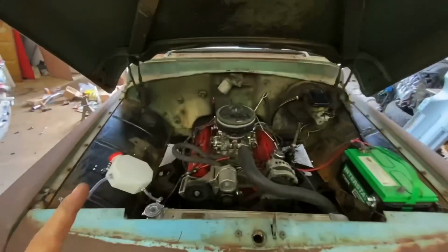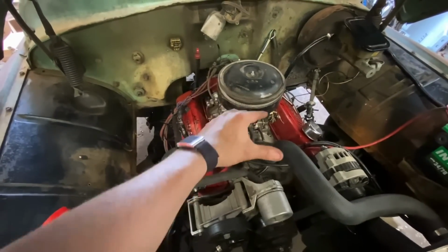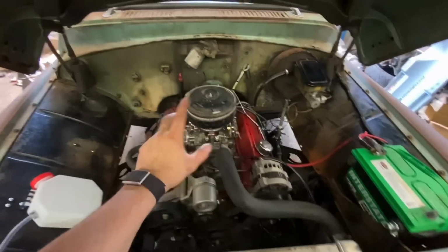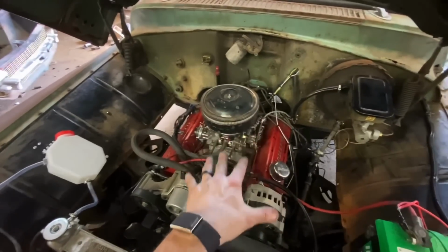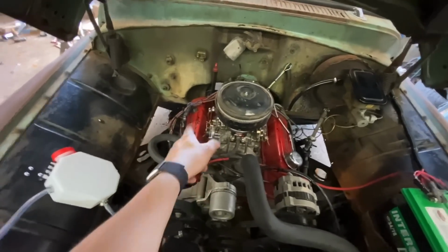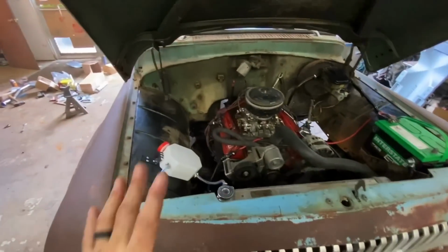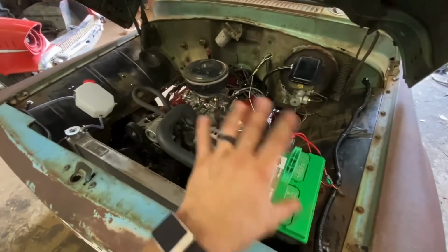Funny story, got it figured out. The electric choke, there's something wrong with it where it is leaving the carb open just enough where it's sucking air. I unplugged it, all my problems went away, so I'm just gonna leave that unplugged. I think the fact that it's 87 octane and not a higher octane is probably some of our problems. If you were running a 91 or 92 octane, you could probably plug it back in and you'd be fine, but we're good. Everything's okay. I'm not worried about it. It still starts up great real fast, so it doesn't need the choke. It'll probably end up needing the choke in the wintertime, but for now, she's cool.